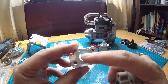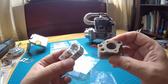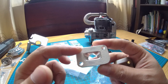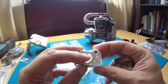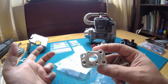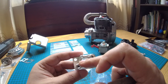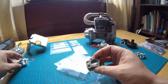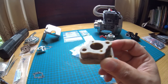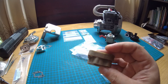You can see the hole — the intake is smaller, much smaller. So I will not be using this one. I'd have to file all of this down and make the hole bigger so it matches, because as of now this hole is smaller than my V-stack — air coming through the V-stack would just hit this wall. So I'll go with the stock one for now. In the future I'm thinking maybe the RB Innovations intake manifold for the G320, as Botugel recommends. For now I'm going to run it and just keep an eye on it so I don't crack it.